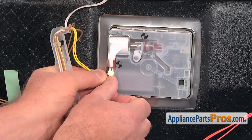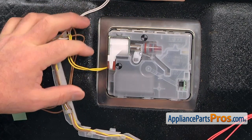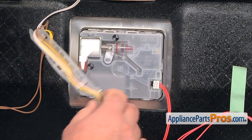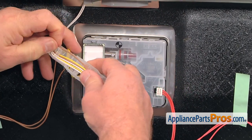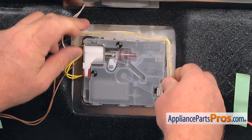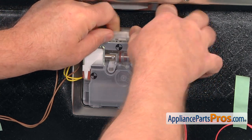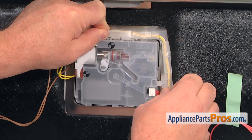We're going to plug this plug on the left with the double yellow harness. Now I'm going to plug in the triple red harness plug on the right. And we're going to install this bracket with harness on the top of the dispenser. I'm going to slide these two tabs into these openings, back in, and then slide this in on the right.